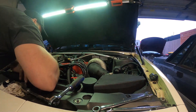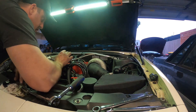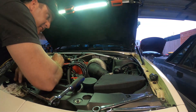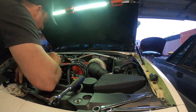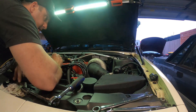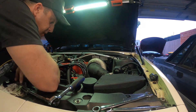Alright, so I was getting 55 PSI — obviously the oil is cold, so I'm hoping that when I warm the car fully up it should come down to 40. What I might do is take it off the jack stands, run the car down, let it warm up fully, then reassess and check everything for leaks.